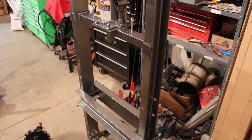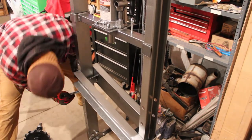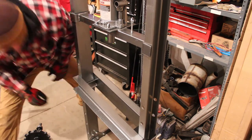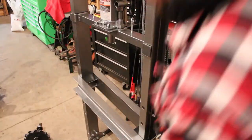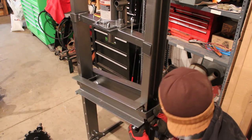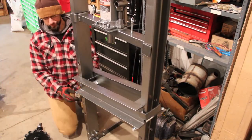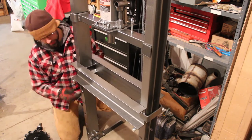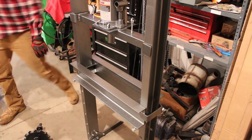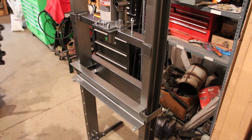Alright, so we're going to take the drive shaft that I just picked up off eBay. Come on, man. Try and get the old bearings pressed off of that, because I was able to get a new set of bearings and seals. And then once we get the bearings pressed off, we'll pull the snap rings, press the drivers off, and then kind of do the same thing with the Renegade drive shaft, to get those drivers pressed off and then try and get them pressed onto this axle. And yeah, go from there.